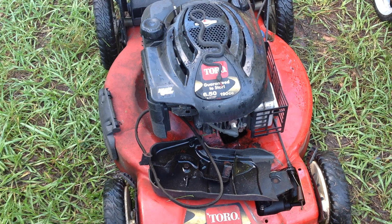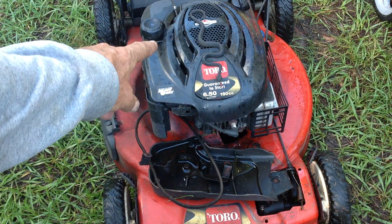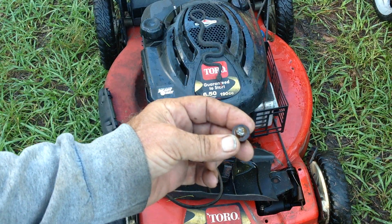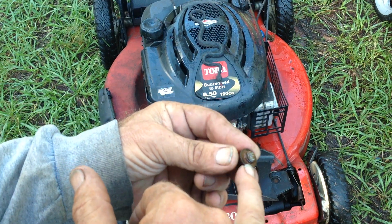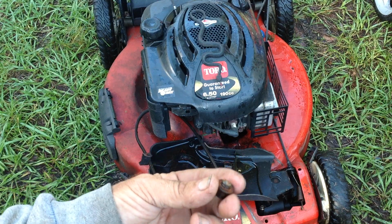Blade is bent, there's a vibration, and the blade shaft is not bent, so we got another blade issue with this 2009. Also, when I was under there, I noticed there's one engine bolt missing, 2 out of 3 are on, and then I see in the little pile of parts, whoever took off the blade guard here broke off the engine bolt, so I got more work to do getting the stud out of the block. I'll have to mess with that.